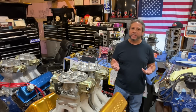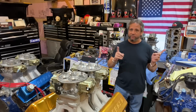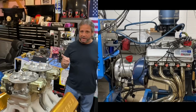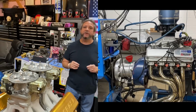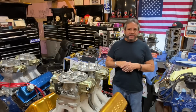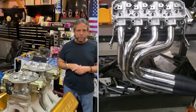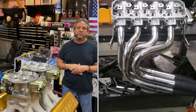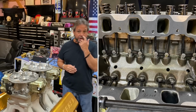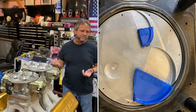It's 409 cubic inches. Now, when I had dynoed that before at 408 cubic inches and then at 409, at 409 it made 775 horsepower. And that's with Scott Cook's Air Supremacy intake and a billet APD Dominator. When it made 775, I also put 2-inch dyno headers on it. And that's where it really picked up horsepower. I think really the problem with the 409 is I have too much head on it and not enough engine. It doesn't have enough compression. It's only 13.3 or 13.35.